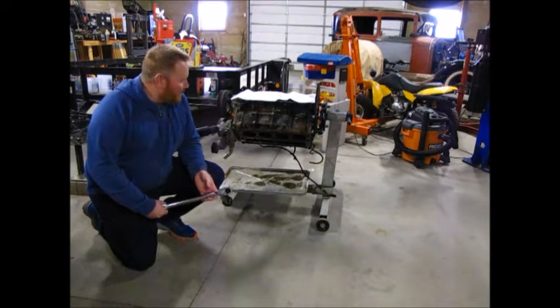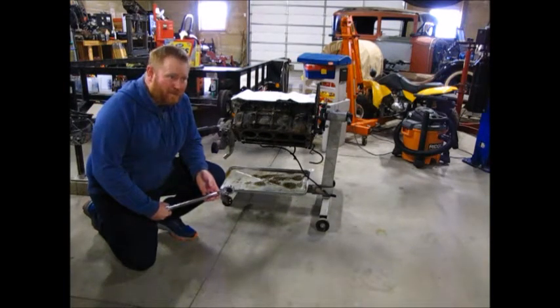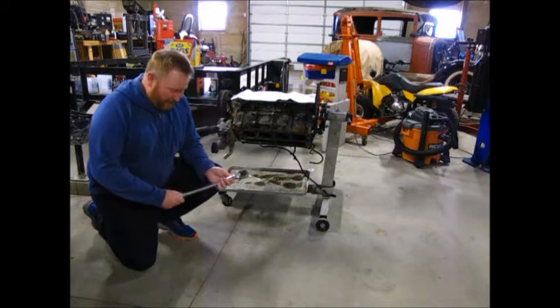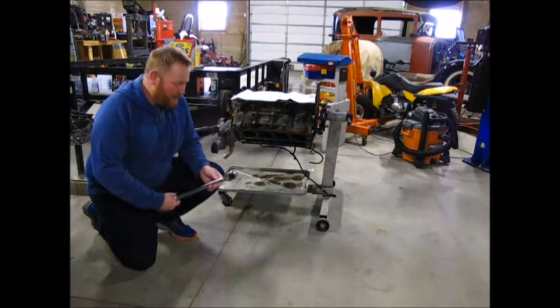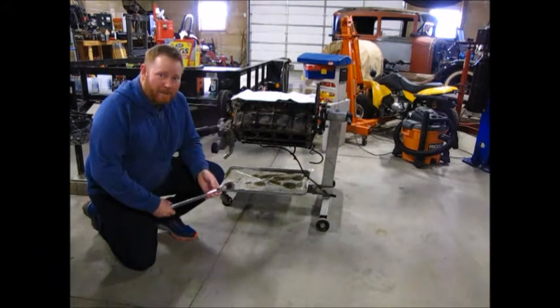I went looking up what to retorque stock rod bolts to, watching Matt Happel work on his 997 horse motor for the Colorado, and he was testing out his torque on the bolts, and it was all 50 to 55 foot-pounds, and he said, just do that and Uncle Matty says you'll be alright. But if Uncle Matty's wrong, Uncle Rodney will come to visit.